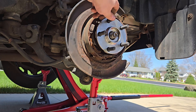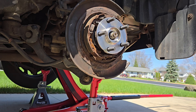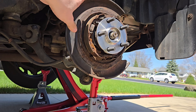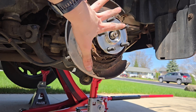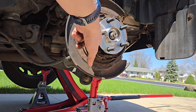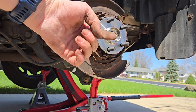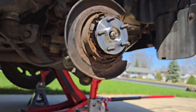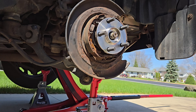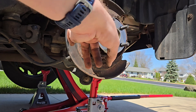The rear bolts are on and this is in there now. What I found easier was to put the bolts in through the back, then slide the parking brake bracket onto the bolts, then put the hub assembly in. I looked through here and could see when we were touching the heads of the bolts, and it was easier to jiggle around from this side and see when the threads caught from the back side. I was able to start all four of them, then go in and pattern-tighten them down, snugging them all and then tightening one, two, three, four.